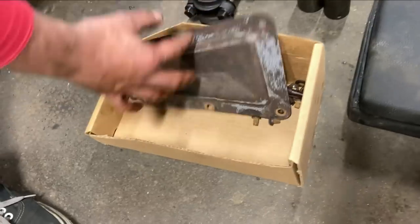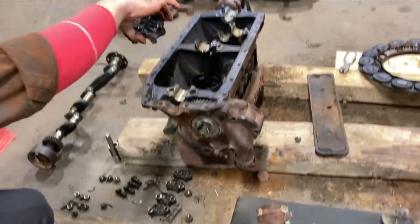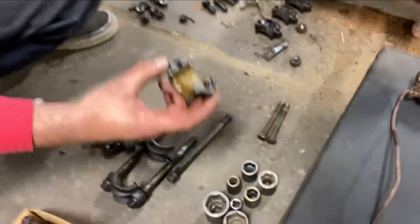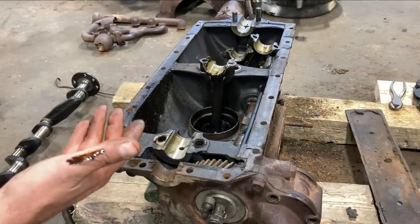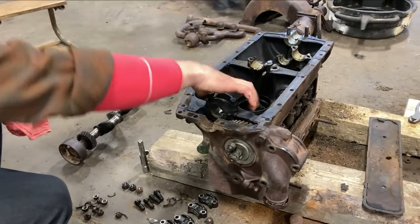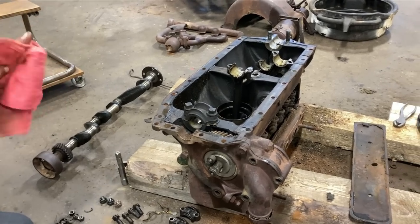This is the transmission cover. Here are our main bearings — these fit on the crankshaft. They're Babbitt, Ford Babbitt, and they're actually in reasonable shape. These are the rod caps, same thing, in reasonable shape. Here are some shims for the mains, because that's all got to be shimmed. How these work is there's a mold placed in there and they're poured in place, then shimmed and line-bored all together to fit the crank.